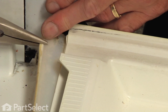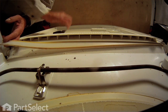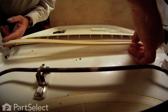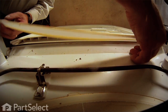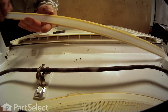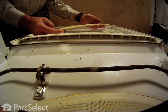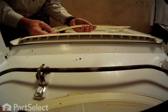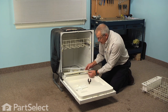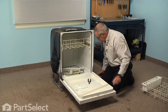We need to take note of how that gasket fits in there. There's an arrow-shaped lip on one edge of it that actually has two ribs on it — that is the side of the gasket that will push into the door. The other edge has one strip on it that has a slight bend downwards, and that's the orientation we need to put the new one in with the single edge pointing down. So we'll discard the old gasket.